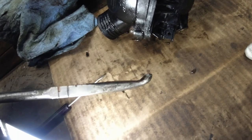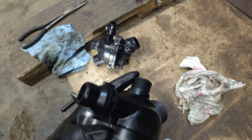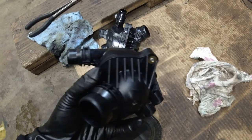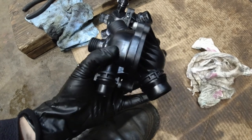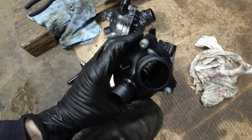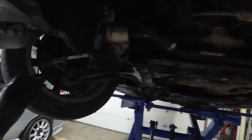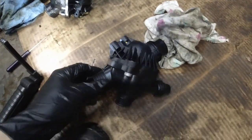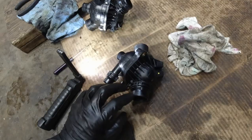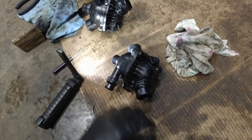With this kind of tool I grabbed the connector and pulled it down. Now I'm going to start with the hose that had difficulty coming out — I'll apply a little lithium white grease on these connectors so it seals up a bit better and is easier to push in. This hose first. You can actually reach around the back where the rack and pinion tie rods come out, reach around, and push that hose in. Then these should just clip in, then the electrical connector, and the rest of the hoses — that's pretty much it.